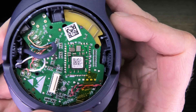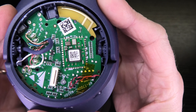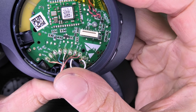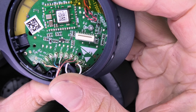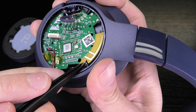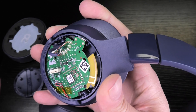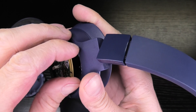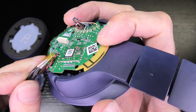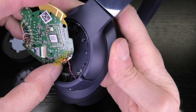Let me show you this up close for a detailed look. Let me also zoom into the area where the wiring goes to the opposite side — you can see how many leads are going through there: one, two, three, four, five, six, seven, eight — and then the white wire going to the front of the transducer. Now let me try to pry out the PCB so we can look at the back side, being careful not to rip off any wiring. On the right side we have black and red wires going to another microphone used for phone calls. I'll detach this little strip and extend the wire a bit.